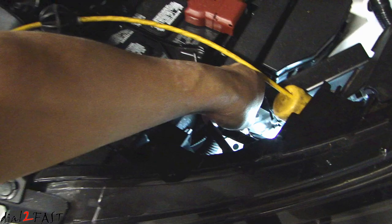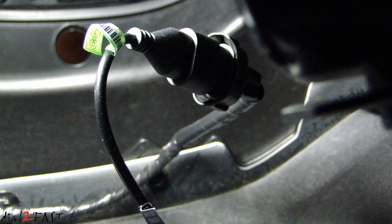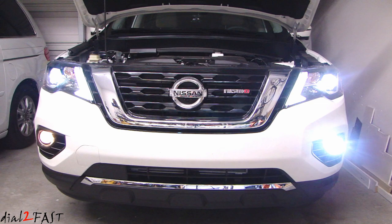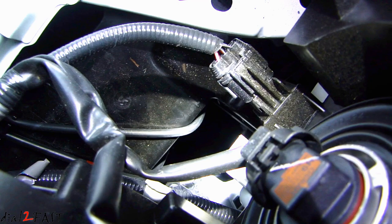Here's the halogen bulb. Now we'll install the LED lights. Here you see the LED light installed. Over here is the connector that connects to the factory harness. Here's a look at the LED light installed without turning it on. Let me give you a comparison look between the LED light on the driver's side and the halogen bulb on the passenger side. The camera is showing the LED light with a blue tinge, but looking at it right now, it's pure white — there is no blue tinge to it. To install the light on the passenger side, there is less room to put your hand through, but it can be done. You want to reach underneath, right behind that opening, to get access to the fog light bulb.